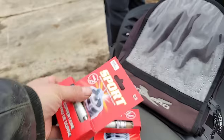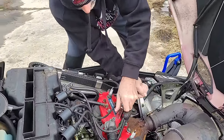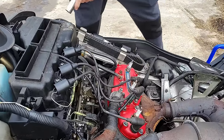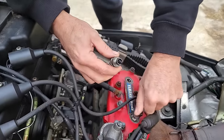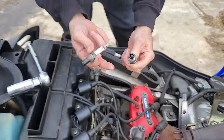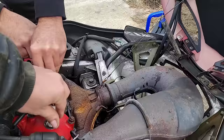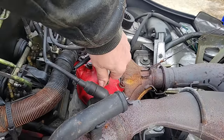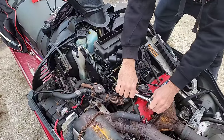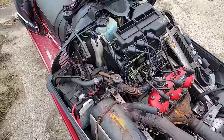He dropped these off with it. BR-9, baby. Not terrible. That one's super wet - she's not firing. All right, we've got them out of the package, we're just going to eyeball the gap right now. We just want to get her inside, she's freaking cold out here. When we get her inside we'll have to do a compression test on her just to make sure. Should be perfect. The redhead's never dead. That much right there - that's the perfect torque right there. It looks like we got little signs of Mickey Mouse down in here. Now let's see how she sounds. All right, take two.